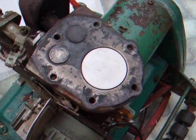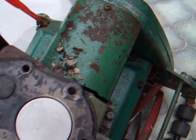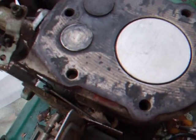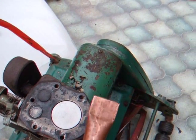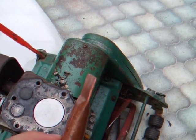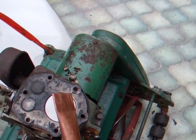I finally got the old gasket off — it took quite a while. You could see all the bits of it all around the engine. I scraped it off with a bit of copper pipe, just flattened on the edge and then filed a bit, because that's softer than the block so it doesn't scratch it.